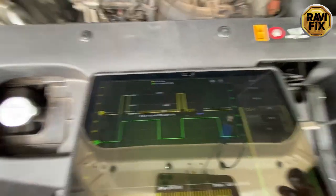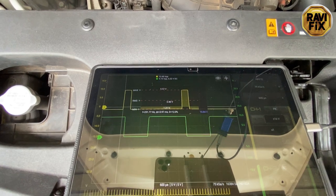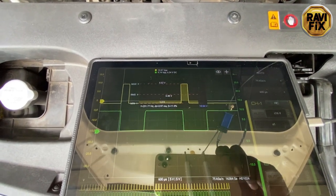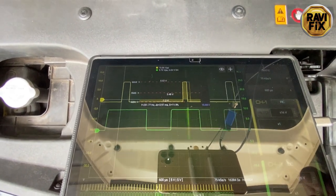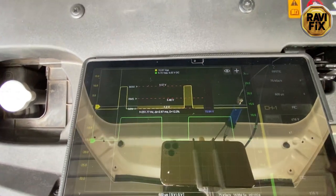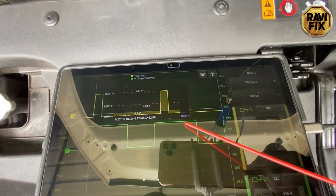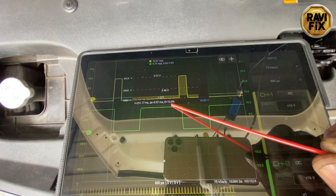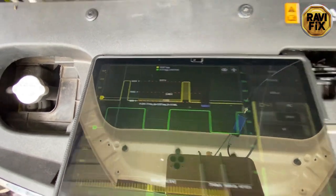Let's go to the scope test. You can see signals rolling on the scope screen. I'm using a scope hardware and software which is very helpful for automotive diagnostics - it has useful measuring tools and functions. The yellow trace is the actuator feedback pulse to the ECM, and the green trace is the pulse width modulation signal from the ECM to the actuator control motor. I have already applied the PWM measuring overlay on the yellow trace, which is an excellent feature.